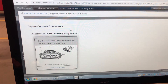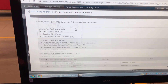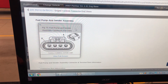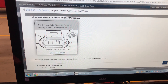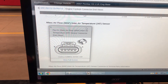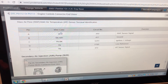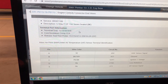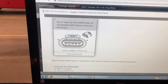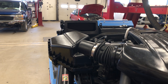All these links have been put in ProDemand so I can find it. I'm scrolling through until I see the combination mass airflow sensor intake air temperature connector. Terminal D is a tan wire — it's the low reference circuit. As I look at the connector, D should be second from the left. I'm going to connect to that and measure the resistance.